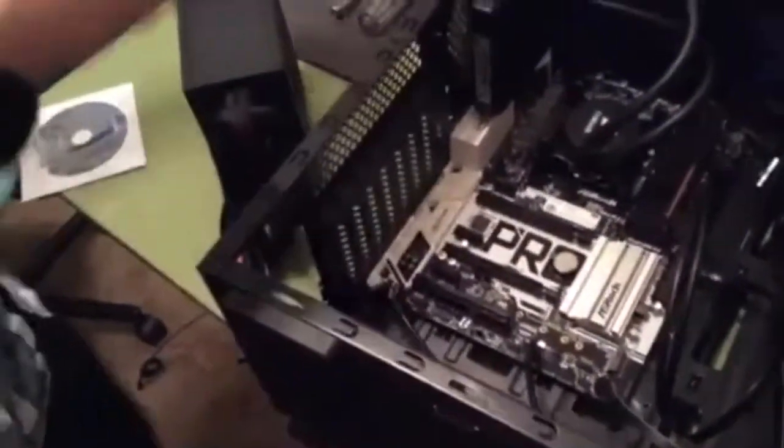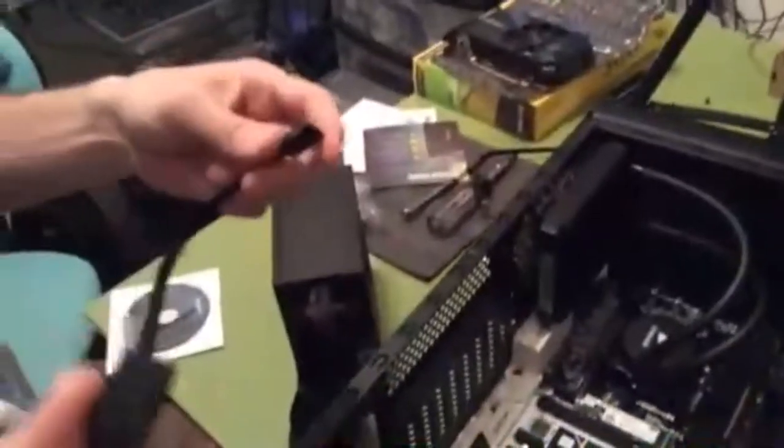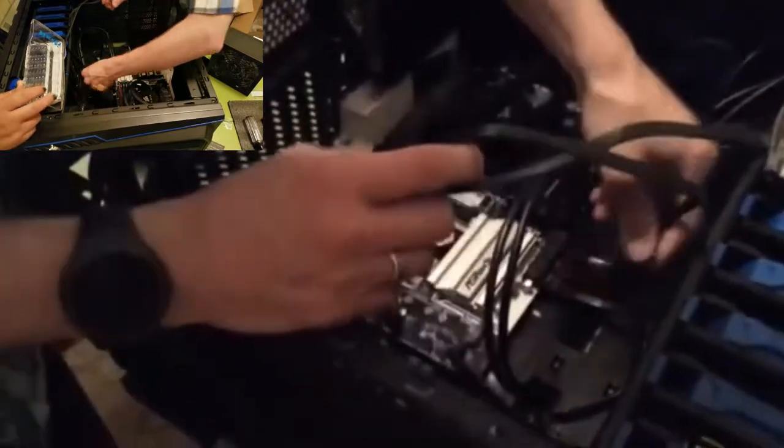And then here are your SATA 3 drive connectors, which we're only going to need one of. Reason being is because... Oh, no, you're going to need two, because you have the Blu-ray. I forgot about the Blu-ray. It's the most important one, that's what I forgot. So with this one, thankfully, we have top-mounted ports, so we'll have it on 1 and 2. Actually, I'm going to do it across the bottom because these have locking SATA clips on them to lock onto the actual device. So we're going to do that. I'm going to pass this one through the bottom for now because that's going to go to the hard drive. That one will just connect straight to the Blu-ray.